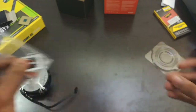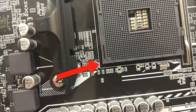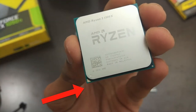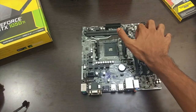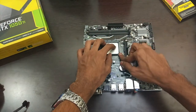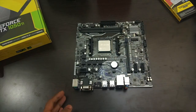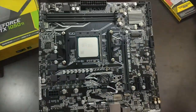Let's start assembling the parts. Starting with the motherboard, look for the arrow near the CPU socket and match it with the golden arrow on the processor. Remove the lock and insert it gently without any excess pressure. Remove the screws for placing the cooler — there's no need to remove the back plate which is behind the motherboard.